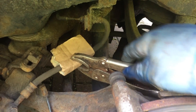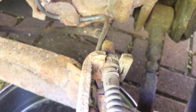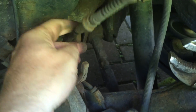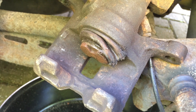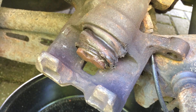Now I'm going to go around to the foot brake after disconnecting the handbrake cable, which will allow the whole unit to become free once we finish bleeding all the oil out. Now just keep pressing the brake pedal until the piston comes all the way out and oil starts to leak out.